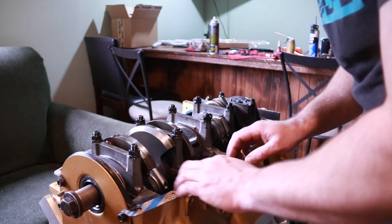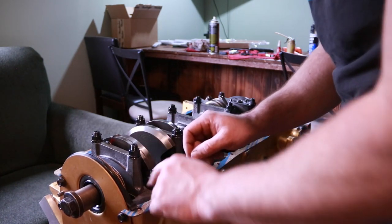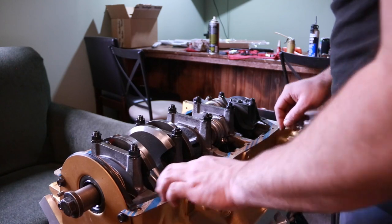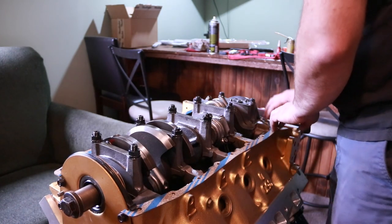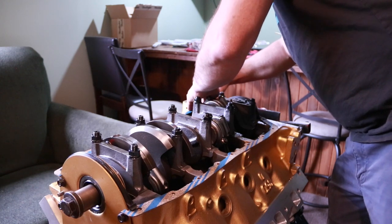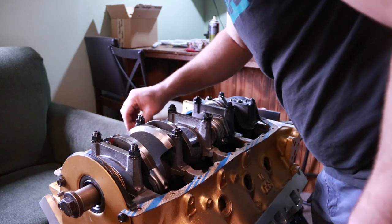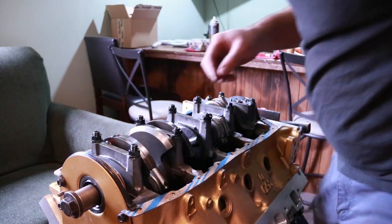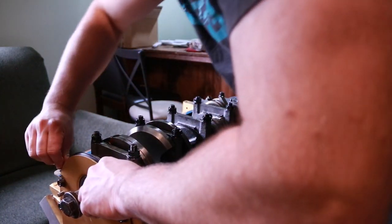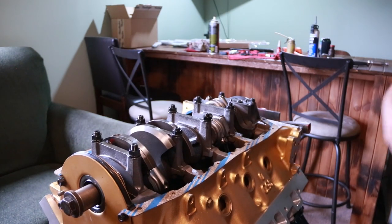And if you run into any areas where your silicone line misses, just lift the gasket back up and put some more in there or smear it over to where it's going to actually do its job sealing. Oh, excuse me. It's a lot easier to fix that now versus having to get this in a car and then find out that it's got a leak and then you've got to fix it in the car. I can finish pushing this front seal back down in the corners.